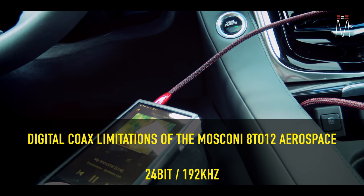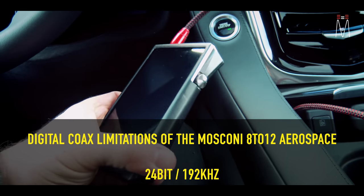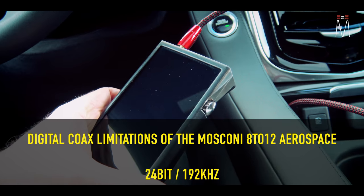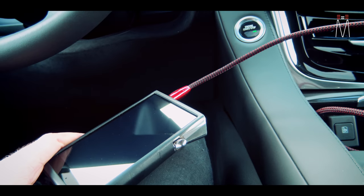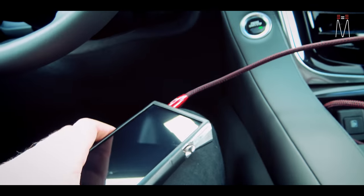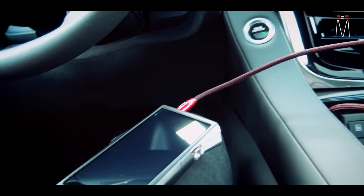by the DSP. Also, you're not utilizing the DAC of the player. If you're not using the analog, you're not using the DACs of the player. And that's, hello, kind of why you buy the player. That's why we use the analog output. You can play everything going through the player, DSD, anything the player can essentially process and decode, again, analog output into our processor.